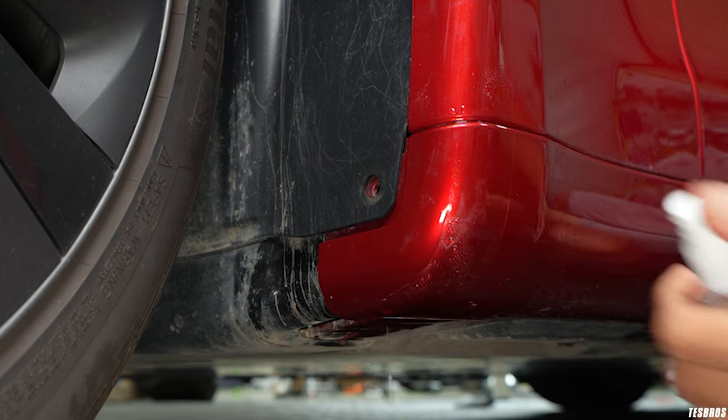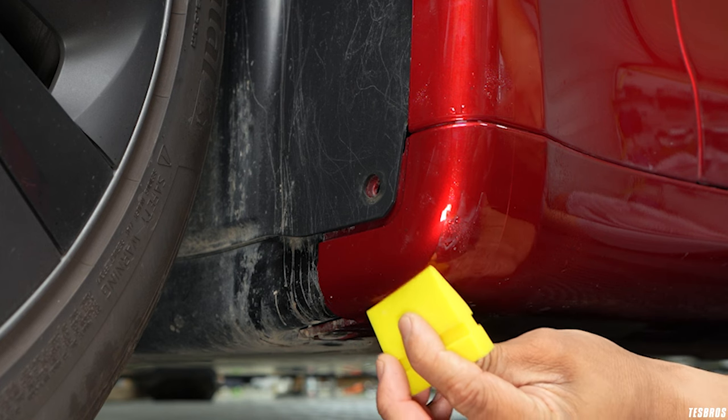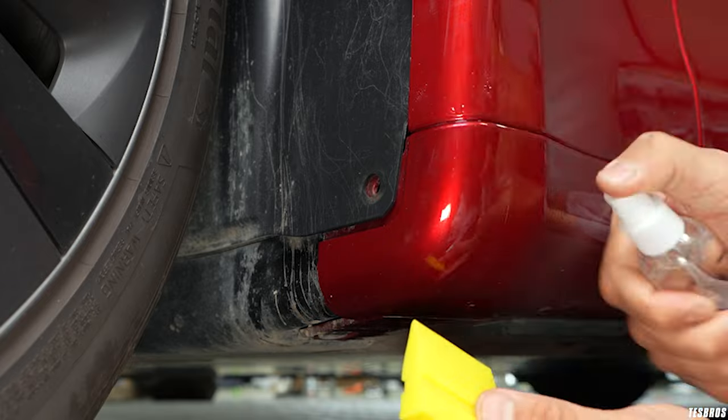Once you feel comfortable, stretch it across until you don't see any more wrinkles. What we're doing is stretching this piece so that it expands and really goes into that compound curve of the rocker. Anchor the bottom portion of the piece and then squeegee the rest of the flat area out. Since this has a compound curve, you may have some fingers lift up right where the curve is. Spray more tack solution and gently squeegee out all that area until all fingers or wrinkles are out. If wrinkles persist, one pro tip is to use a microfiber to wick up the moisture in that area and hold it down — for the most part it should go away.